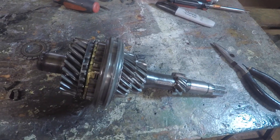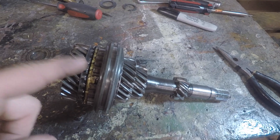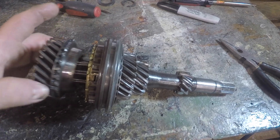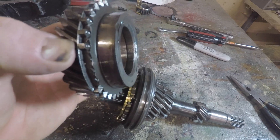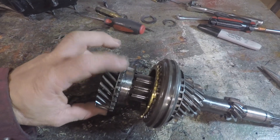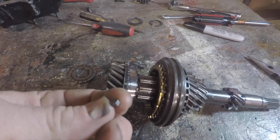I have a dilemma and I'm not exactly sure what to do for this transmission that I want to fix. This is my transmission which is popping out of fourth gear, and I bought it on eBay. If I look at this gear, which I think is a fourth gear, it's missing teeth — there are teeth missing here, here, and here. Inside the transmission I found one, so I don't know if it's from this gear.